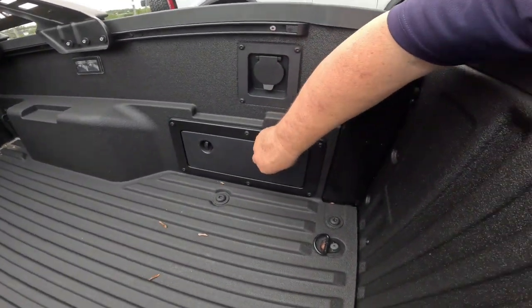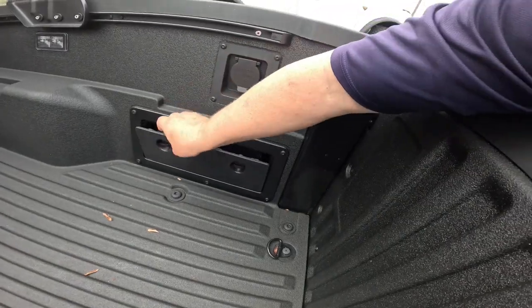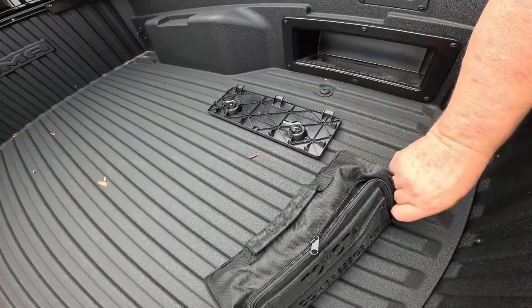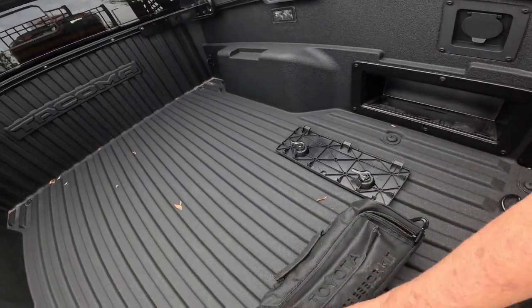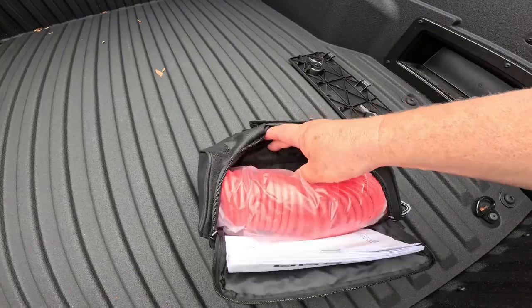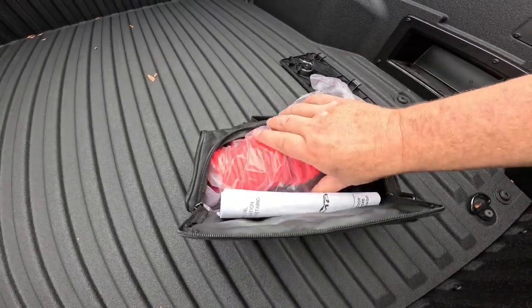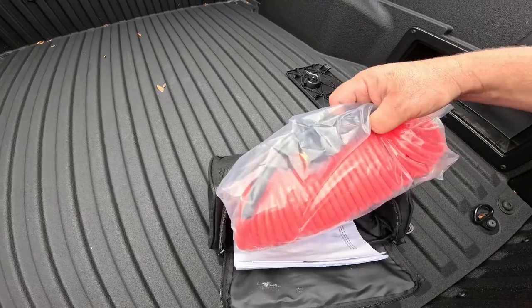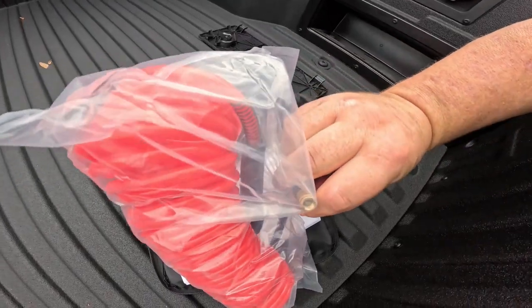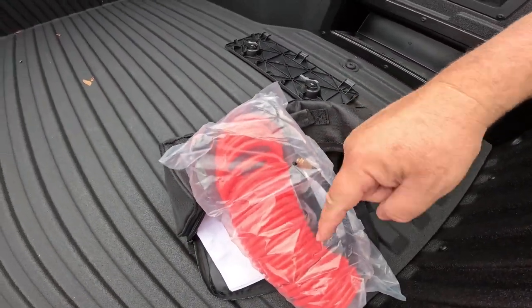You might ask, well where are all the air tools? On the opposite side of the truck — over here you unlock this, pop it down, and you've got a bag which has your Toyota compressor kit. Undo this right here — open it up — and you've got your compressor hose, which should reach all of your tires. It hooks up to the main system, and then you've got the little end that goes onto each one of your tires. It screws on, so you set the gauge to exactly where you want it, hook it up to the tire, and then you can walk away.